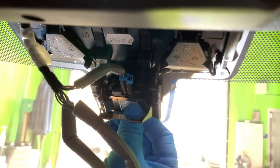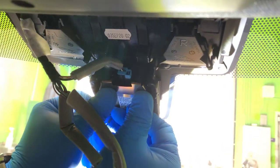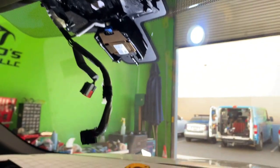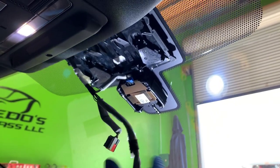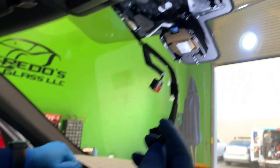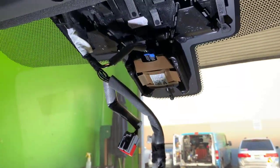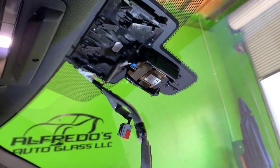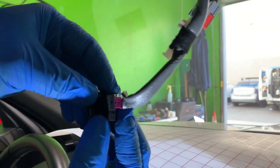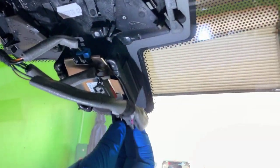There were no bubbles — glory to God. Now it's time to put the — remember, as I was saying earlier, don't lose this little clip, because this is what holds your condensation sensor. So this goes right here and it grabs the condensation sensor. Then you just guide it and it locks in place — there's a little guide in the center. It locks in place. Then push this back on here. Now I'm going to install the upper cover first because I'm going to have more space right now to put it on.